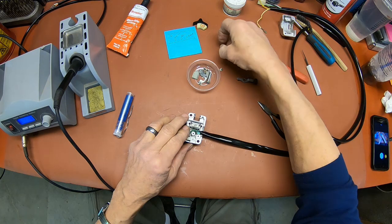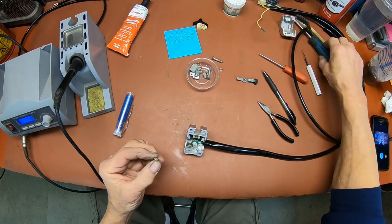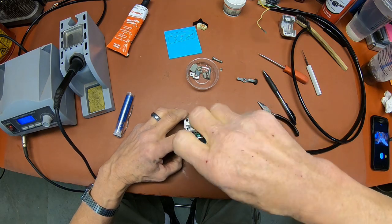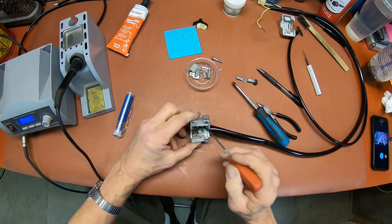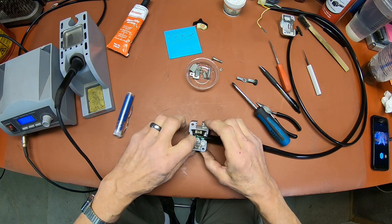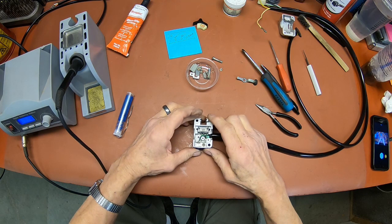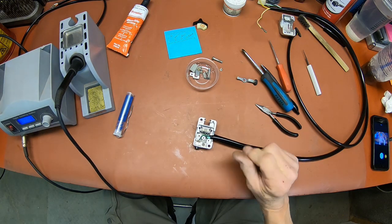And figure out which screw you're going to need. It's a little flat one there. These, just kind of get them, fits down into a little groove in the bottom down here. One side of that does. And I've taken this apart, kind of like this other switch, and cleaned out the inside. The horn buttons are real good about getting corrosion inside of them. So you get them in there, them or electric start buttons, either one. So you want to make sure you clean those good before you put them back in.